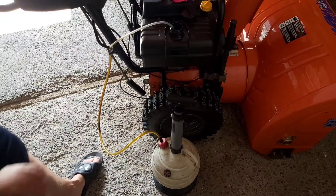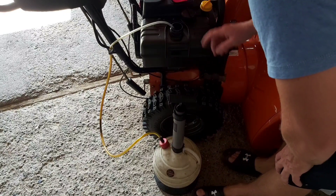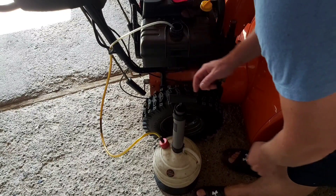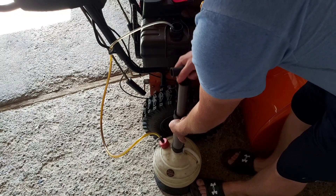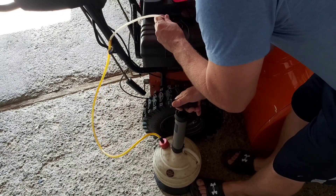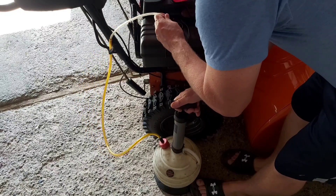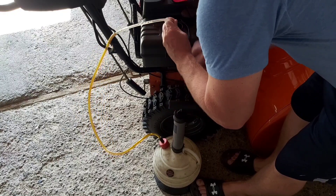What we're going to do is drain the fuel that's in the tank. I'm going to use my oil extractor to drain the fuel. What's left in the fuel line we'll burn off when we're warming it up to change the oil. Then I'll add supreme fuel along with fuel stabilizer. There wasn't a whole lot of fuel left in here.